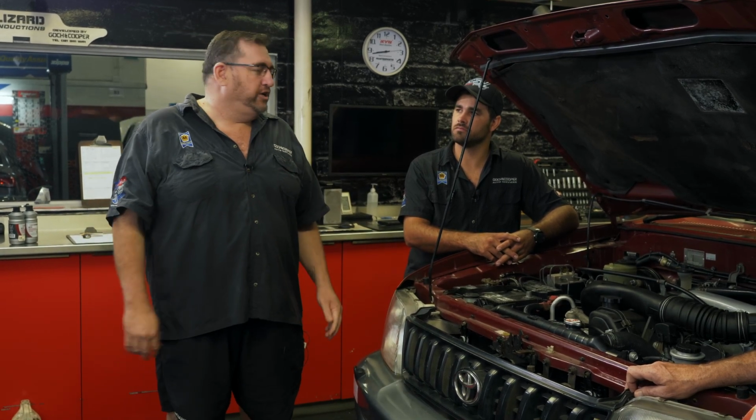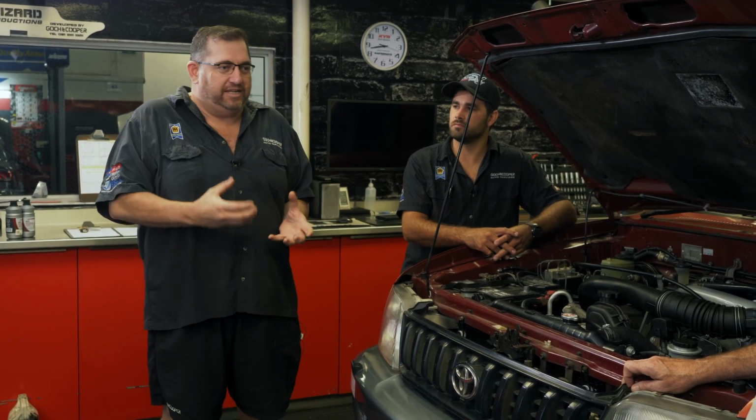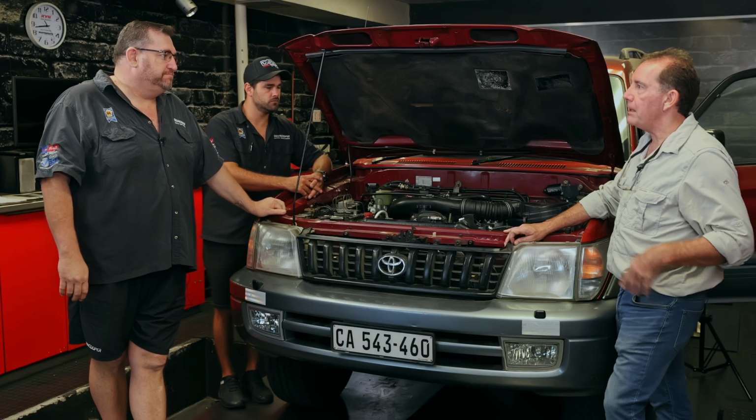We're not going to put a full synthetic oil in a new engine. I think you've experienced that as well. Put that in a new engine, you're not going to give the rings a proper chance to work, to properly bed in and seat in. Yeah. Okay.